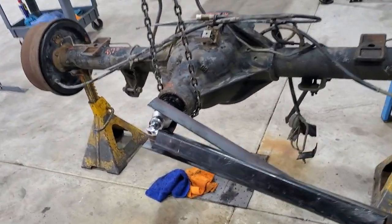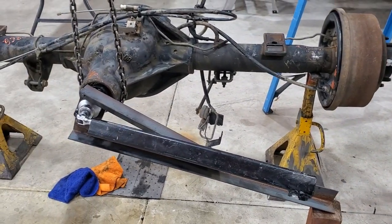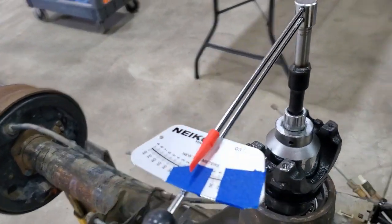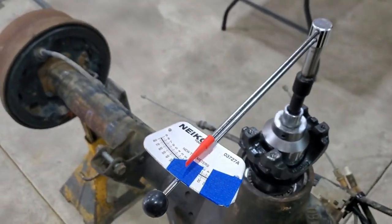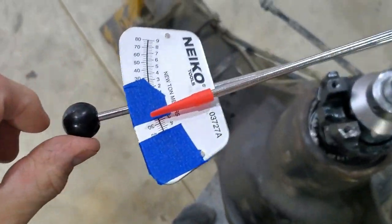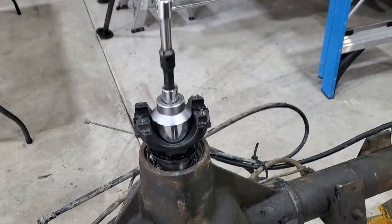After replaying that video, I was looking at how much that breaker bar was bending. So I put a 2x2 quarter-wall tube on it, and it came down probably another half a flat's worth — got to take that into account. I'm going to check the preload on the pinion bearing. The carrier is out, this is torqued to spec at 450 pounds, there's no seal and the bearing is dry. Specification is 25 to 40 inch-pounds. We'll go a couple turns and then try to read it. We're on the low side — about 25 inch-pounds. That will probably work. I think we'll run with that.